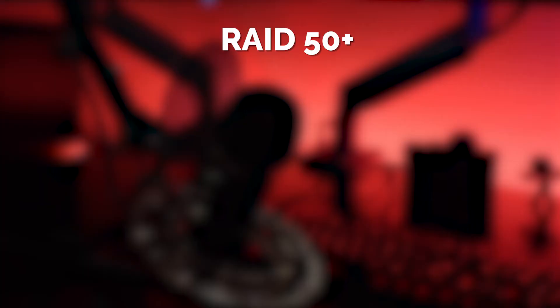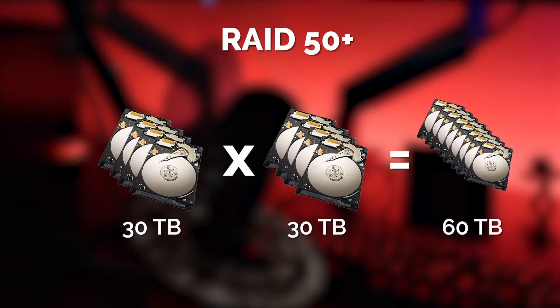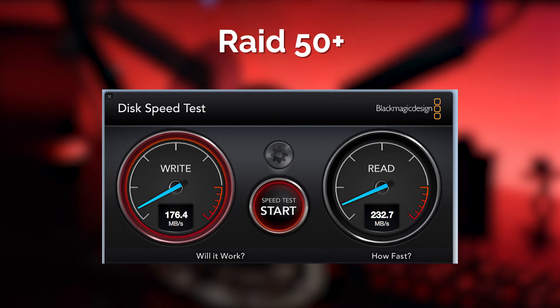Let me talk briefly about RAID 50+, which is RAID 5 plus 0 — you take two RAID 5s, so it's eight hard drives minimum, and stripe them together for much faster speeds and more resilience. You can have up to two or three drives fail in an eight-drive array without losing data. I have two of these at work from MediaSonic, but the downside is they're only available in USB 3.0, which is a serious bottleneck. Even USB 3.1 Gen 1 isn't very good — you need Gen 2 to get full speed and ensure it's no longer a bottleneck for your external drive enclosure, especially with a RAID.